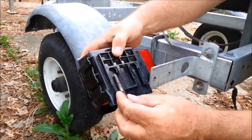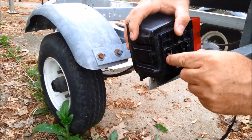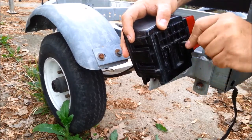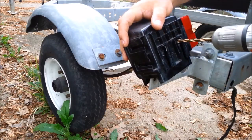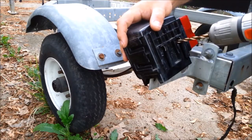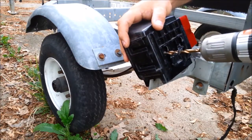Now I need to put that hole in the middle of this slot. About right here is where the head was. I'm just going to push that really hard with my hand and wiggle it around. That should be enough. Let's see if I can drill this hole and stay on center now — that's going to want to wander, of course. There we go. Nothing like a little indentation to make drilling easier.